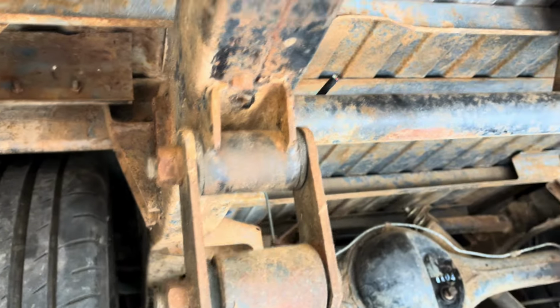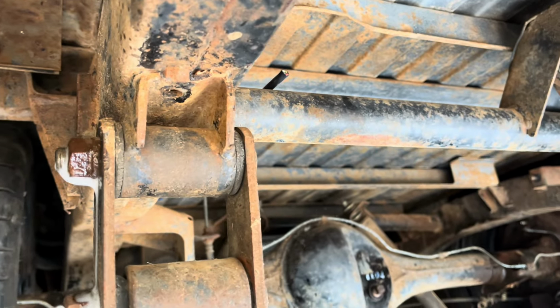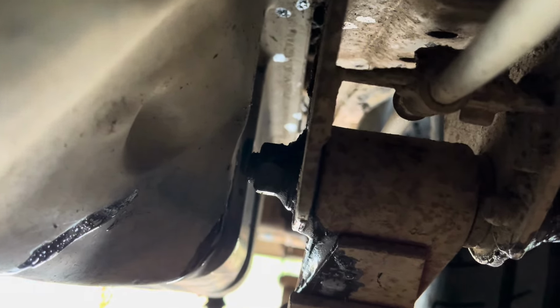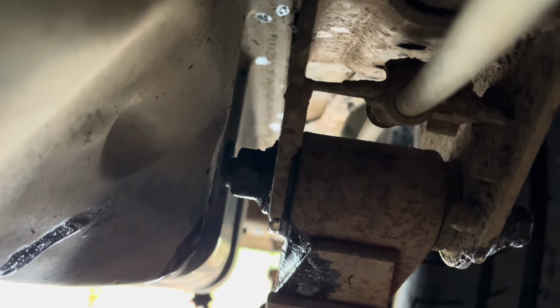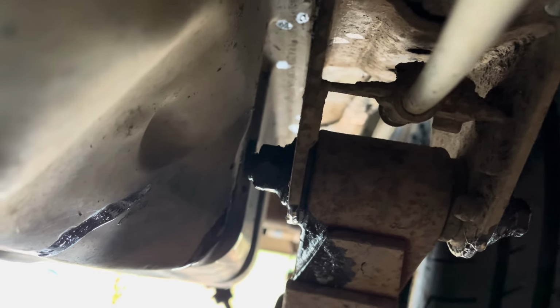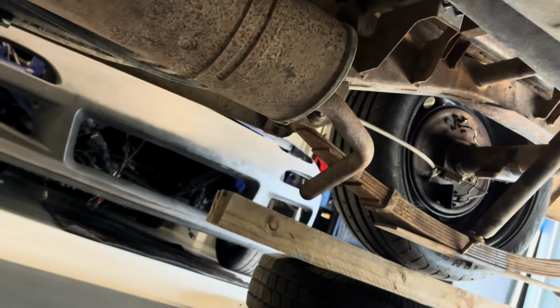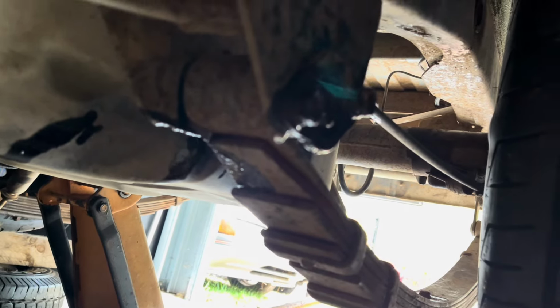All right, again, I'm gonna have to lube everything to death because everything's just a little bit crusty. Now we've got those two bolts and nuts at the back. Well, they're not really bolts, I guess they're just things with nuts on them. We've got those two, and then you've got this one at the front. And you've also got those two little nuts which hold the bush in. I'd recommend starting from the front just because it's always more of a pain in the ass, especially with crap like this going on. You have to do that with the spanner. Should be fun. The other side should be good to hit with the rattle gun. It looks good, so let's get started on that.